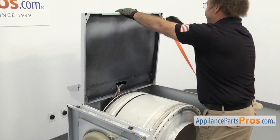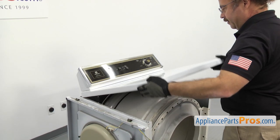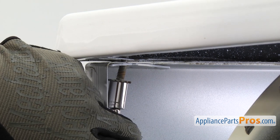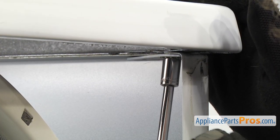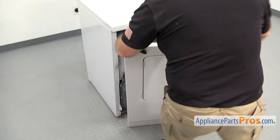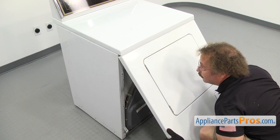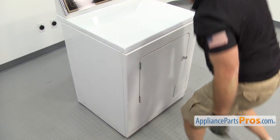To put the top down, we're just going to carefully take the lanyard off and then lower the top down. Once you have it in place, we can use the ratchet with the extension and 3/8 inch socket to put the screws back in that hold the top on. Once you have this one on, we can do the other side. To put the front panel back on, we're just going to grab it and swing it around. You want to make sure that the little tabs right here line up with the cutouts on the top, and we're going to put it in like we took it off — at a little bit of an angle. Make sure the clips go in and it doesn't drop down. Once you have it in place, we can use the Phillips screwdriver to put the screws in.